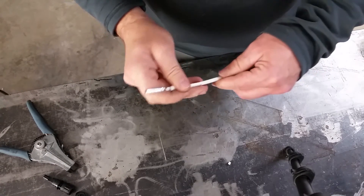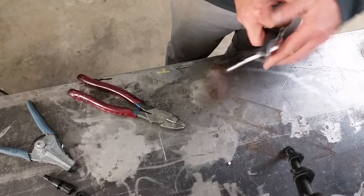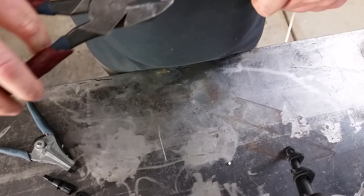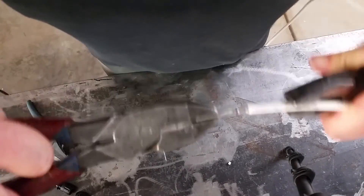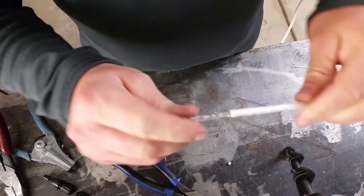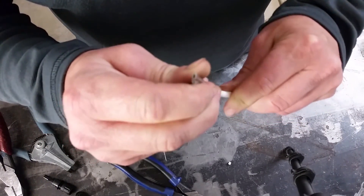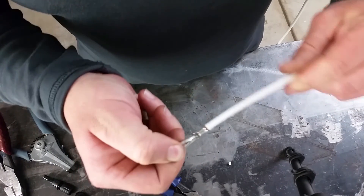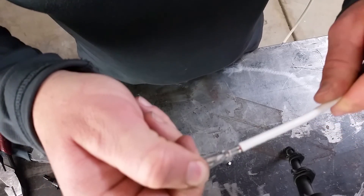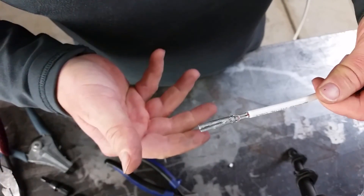Now using a couple pairs of pliers, I'm going to hold the wire and show you — I can't pull this out. That connector is not loose. It takes a lot of force and it's not coming off. These really need to be crimped with a proper tool. You can solder them if you want, but spending a little extra money to get the right pre-made cable is definitely going to make a safer project. Thanks for watching the cable demonstration — talk to you guys soon.